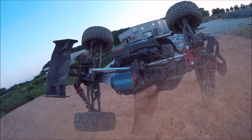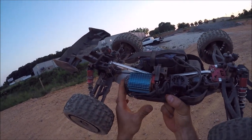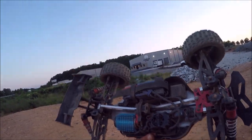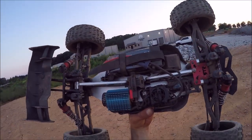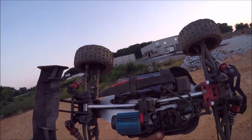All right, guys, I'm gonna go ahead and call it with the Talion. She's getting really hot. She thermaled on me just now, and my motor mount just shifted on that last jump. So I'm just gonna go ahead and call it. This is a fresh pack too, and I don't like to over discharge a brand new pack. It's the Power Hobby 6S.